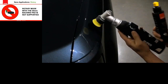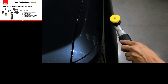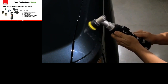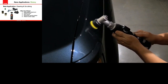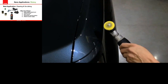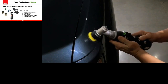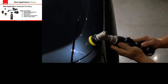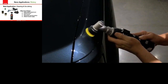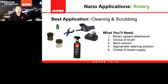Here is the video clip of the rotary application — the nano in the rotary function. We have our yellow polishing foam with ceramic polish and again we're taking a few seconds to prime the pad, get it warmed up, and get the polish spread evenly over the surface. We then reload with one pea-sized dot of polish. One common mistake is applying way too much polish on the pad, which ends up slinging product everywhere. This is a great, very precise edge work tool in the rotary mode — probably one of the best movements the tool can make.